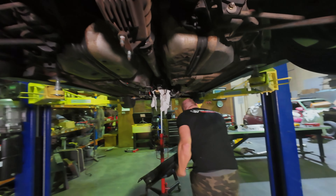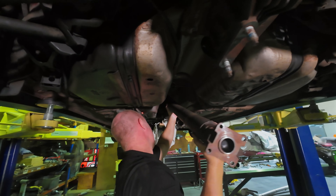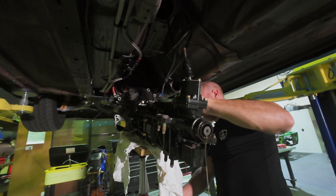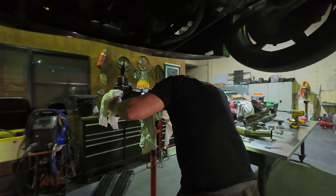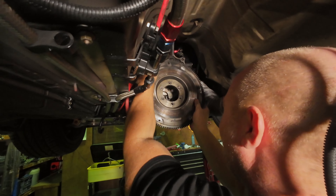Make sure you have the gearbox propped up as the beam acts as the rear gearbox mounts. I then removed the tailshaft from the diff and slid the yoke out of the gearbox. With the tailshaft out, I can slide the gearbox out and lower it down. Make sure you remove the gearbox oil first — I forgot this step and had to catch the oil in a pan on the floor. With the gearbox out, remove the six bolts holding the clutch pressure plate, then remove the flywheel. Now we are ready to install the new clutch.